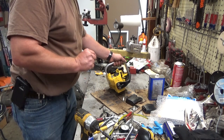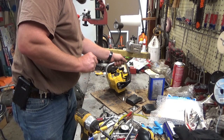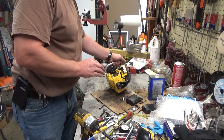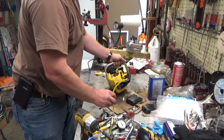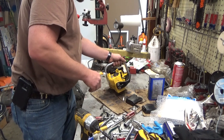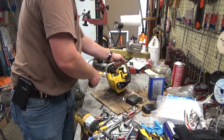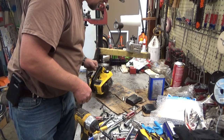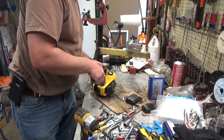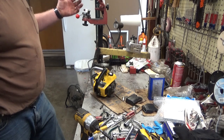I also adjusted the inlet lever spring up just a smidge. So, it has a little more pressure, or it will take a little more pulse in the engine to move it, but I pumped her up to 12 on the carburetor gauge, and it held nice and good, and I don't see the telltale wisp of evaporated fuel coming out of here, so I'm going to call this one good. I'll give it my standard treatment of let it sit for a couple days, restart it, and if it starts without any trouble, it's going to go home.